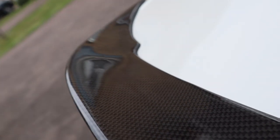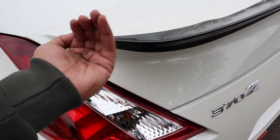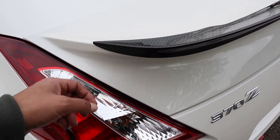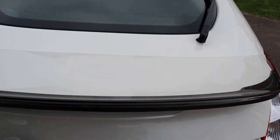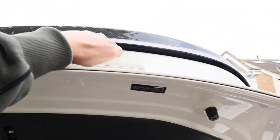Tiger seal is the same kind of sealant used on RWB body kits on a Porsche, so I thought if it's good enough for a Porsche it's definitely good enough for my Nissan. As you can see, there's seal going in between the bodywork and the spoiler. It makes the gap look a little bigger than it actually was because the spoiler curves back in on itself. Underneath, in the inside corner, you can sand that away to get it to fit more snugly — though it does still leave about a finger-wide gap.